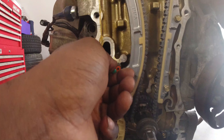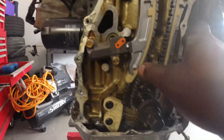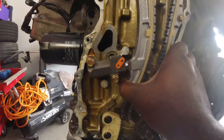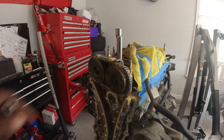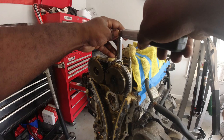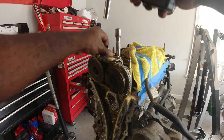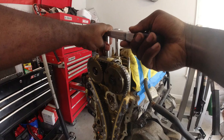Pop this in and now let's apply a little more tension - there you go, now it's on there and we've got tension on it. For those two bolts up top, it's going to be 16 foot-pounds, which is around 21 to 22 Newton meters. Let's get those nice and tight - there we go, and a final turn. That's it.